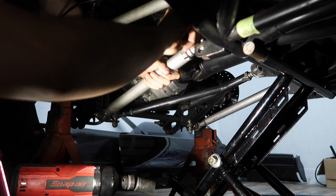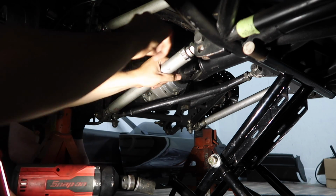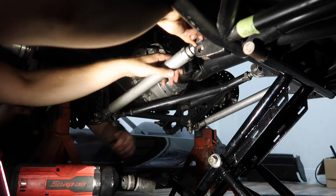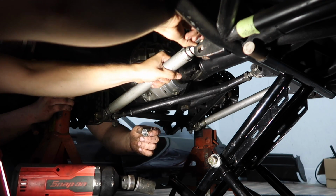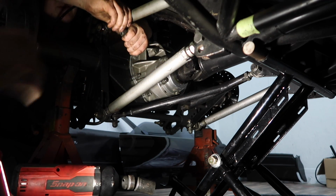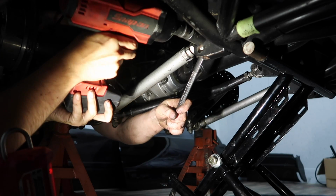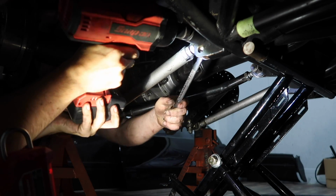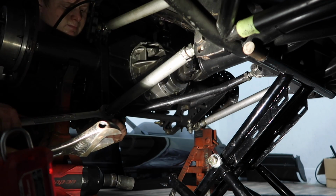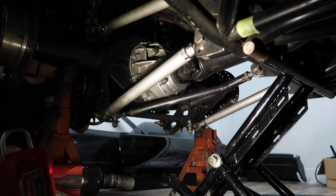There you go. And just take your hammer or your other hammer. So that right there is a little bit of preload. That right there is neutral. You want to put it right there? Yep. Alright. That would be three turns and then back two flats, which is exactly what we did on the other side. Ready? Yep. That one's a happy camper there.